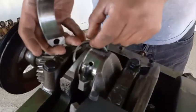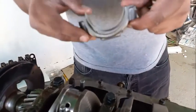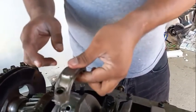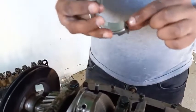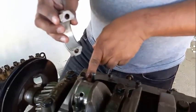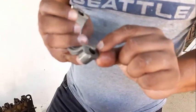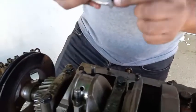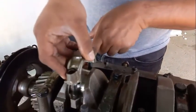Remove the cap, inspect the bearing, make sure it's good, and put it on the side. Remember, this one goes here — don't rotate it. The reason you know is this tang should match up with this tang. You're going to notice this little thing right here — it's a tang. This one has it on this side; you don't want to put it the other way. Always make sure you match it up.